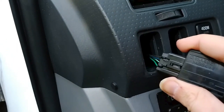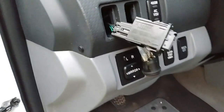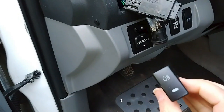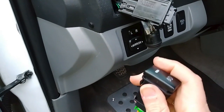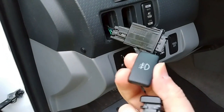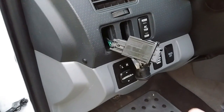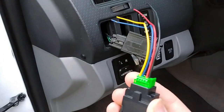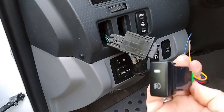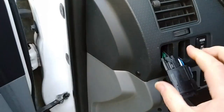There's the original OEM wiring harness, and my plan is to use this switch right here, which is illuminated and has its own little indicator light, since my OEM switch didn't have any light and it didn't come on at all — not with the headlights on or even when you push the fog light button in. The one little annoying thing is that this connector for this little aftermarket light, which looks like it's OEM — that's the whole reason I got it — has a different connector that plugs into the back of the switch than the OEM switch.